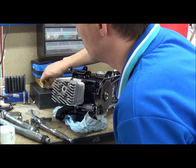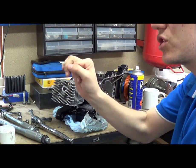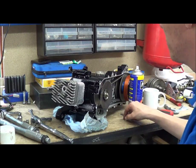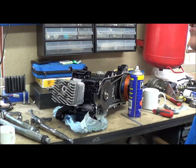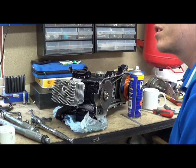Copper wire — you can also use really thick copper wire, not the braided stuff, I mean solid earth copper wire. It's best to use solder just because it's a hell of a lot softer. Copper's quite hard, but I have used copper before, especially in cast iron heads. This clay method is basically the same thing you do for valve clearances in four-strokes, so you can see the gap between your piston when it comes to TDC and your valve clearance when your valves are opening and closing.